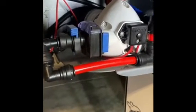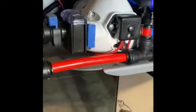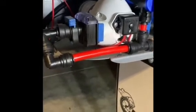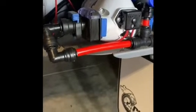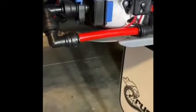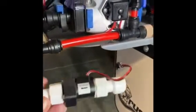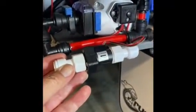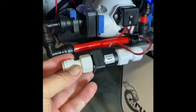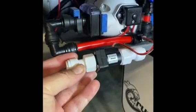The only difference there is we also need to install a backflow stop valve prior to the flow meter, and we'll put that in the line as well. The red hose that you can see there is the inlet, but unfortunately that's also not long enough to place the sender unit in, given that we need about a 200mm either side of the sender unit before any elbows.